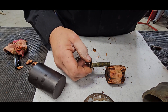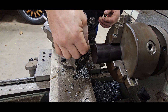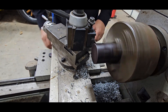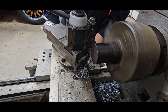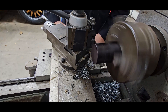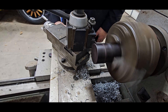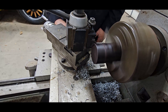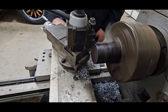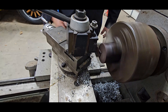I'm going to clean it up, get it over to the lathe, and get this machined. The old cork was two inches, so I've got this measured off with the cutoff and I'm going to go really slow with this. Cuts like butter. I'm tempted to go faster but I don't need this thing flying out of here.